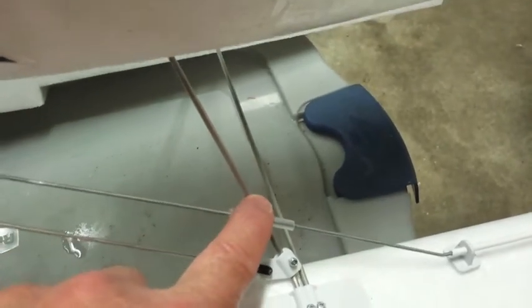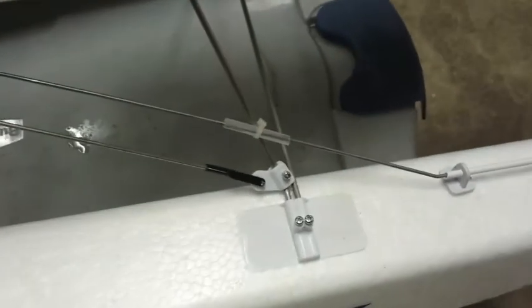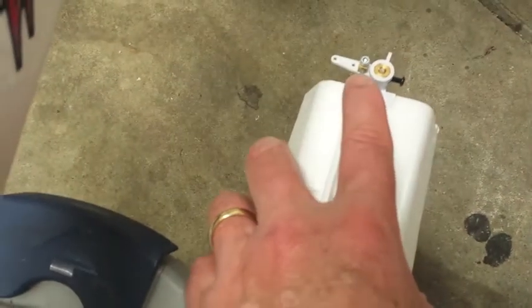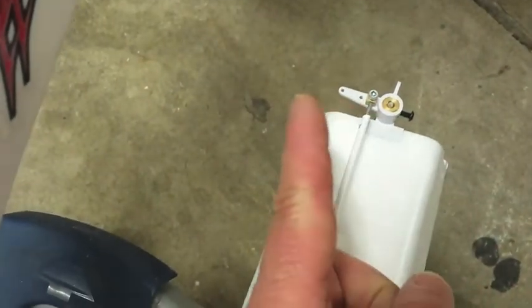I ran the 256 rod long, down on the outside of the landing gear down strut. I've got a little piece of plastic and a tie wrap to tie it to the landing gear down tube. I popped the little guide off and repositioned it so the rod comes straight along and straight into the control horn, with just a little bend right here. I made a hole as close as I could to the center point of this control rod, because that gives maximum throw and maximum rudder movement.